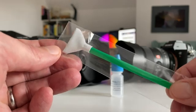So how do you apply the cleaning? Get the swab, apply a little bit of liquid — not too much. The size of the swab matches the size of the sensor. Then with a very calm move, swipe it in one direction and you're done. The sensor will be polished and clean. The high alcohol concentration in the liquid immediately removes any smudging. Do not scrub heavily as it might damage the sensor — just make one or two swipes along the sensor. That's why having the right size swab for full-frame sensors is important.